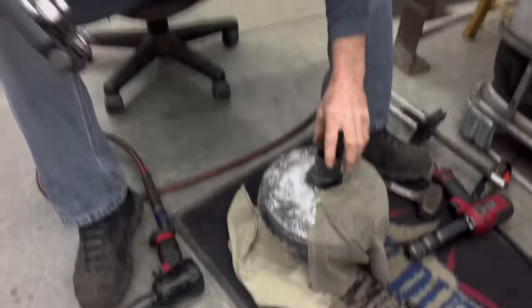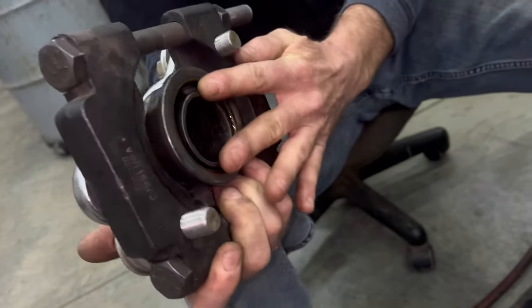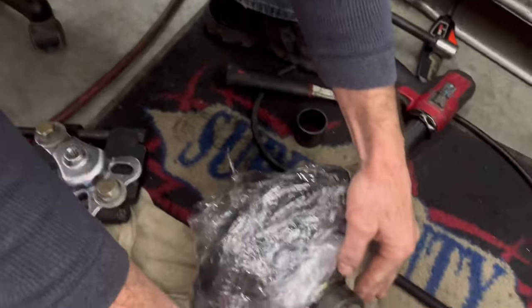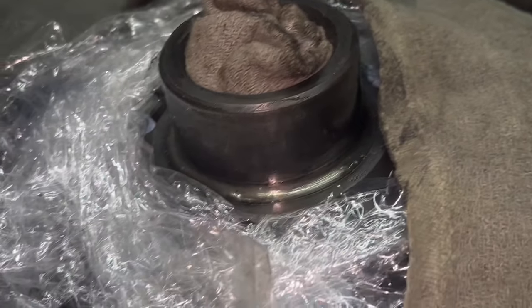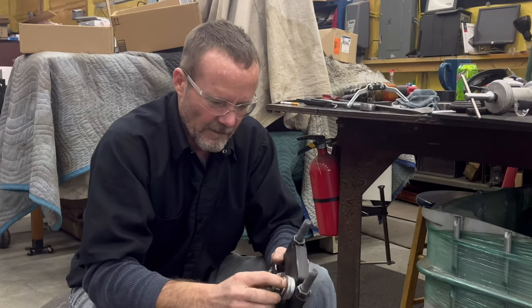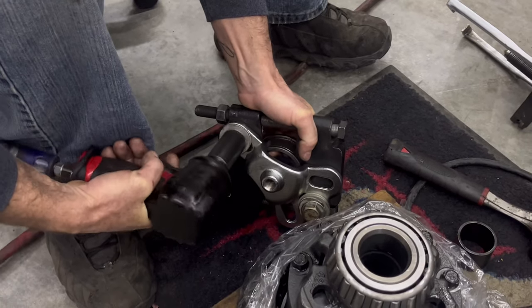Look at that - there's our spacer. That's what I used - it's out of the ball joint press, and it sat right there on top of that hub. See how close it was - it sat right on the hub. It's out! I packaged it all up thinking we might have to cut it - it looks great. I did not want to cut it. Everybody cuts these things off - I don't want that. I've got a bearing puller tool that I just made out of a bunch of crap we have here at the shop. It's freaking perfect - worked great. Got lucky - 15/16 for the size on all of them.